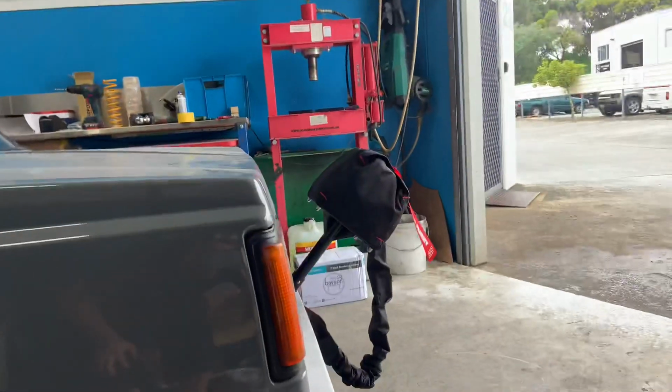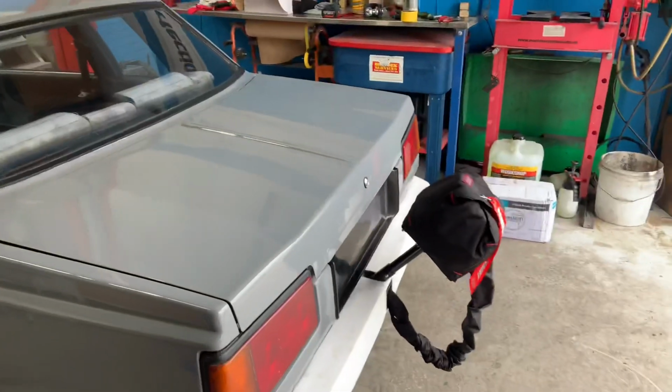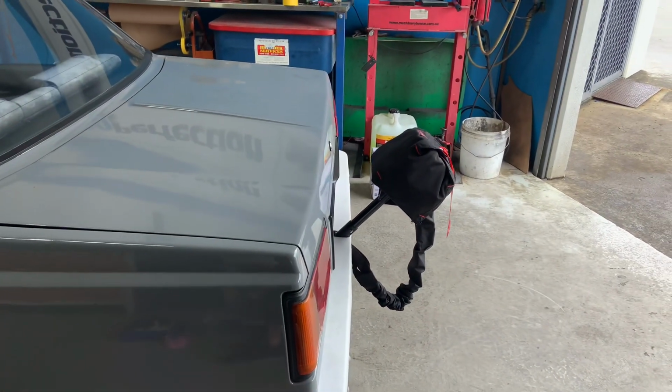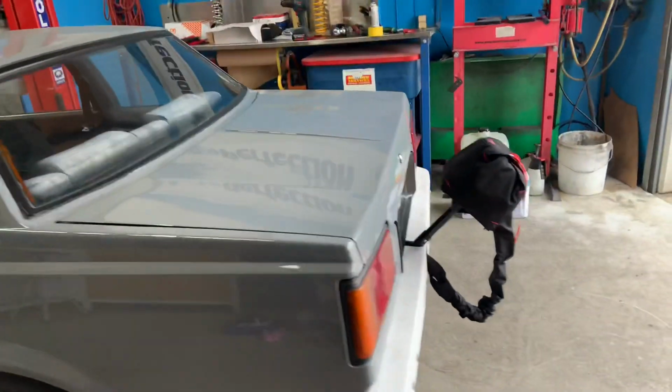So at quite a nice height, 45-degree angle they reckon roughly to run them. I'm not sure, it's the first one I've ever put on. Any car that runs 140 mile an hour requires a chute on the back. So 140 mile an hour plus, which I'm hoping this car should do fairly easily, but time will tell.